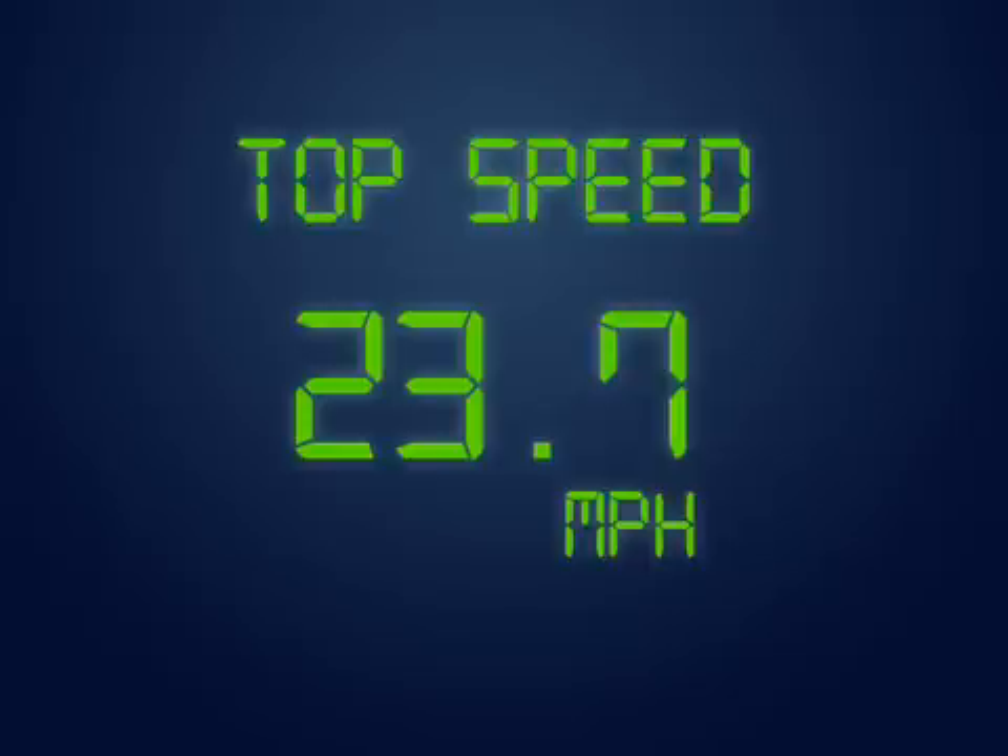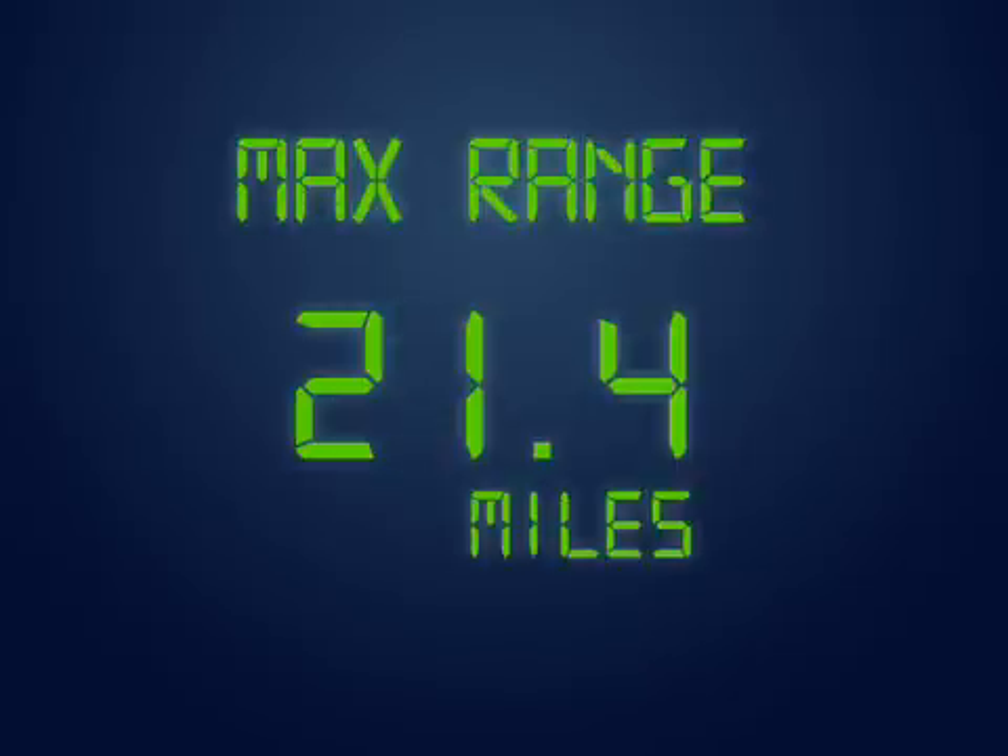On my initial run with a fully charged battery pack, my maximum speed without pedaling was a decent 23.7 miles an hour. With a strong headwind I couldn't get more than 20 miles an hour. I found that even in the highest gear I couldn't pedal fast enough to keep up with the motor, so on this particular bike that's the top speed. On a higher end road bike you might be able to get a little more out of it. The second test was done with another fully charged battery to determine total range. There is a significant degradation in performance as the battery runs out — once the throttle indicated half charge, my top speed was down to about 19 miles an hour. Using almost no pedaling through a residential area, I was able to go about 17 miles before seeing significant performance loss, with a total trip of 21.4 miles. Since the SLA battery shouldn't be drained more than 80%, I would say 20 miles is about the top range.